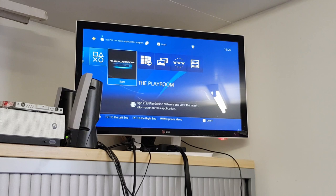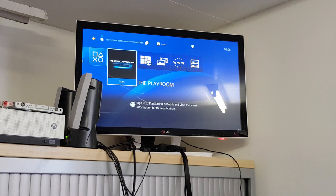Yeah, you can hear that. Yeah, the disc drive isn't happy. It's not accepting this now. It's not feeding. So it would appear that the drive mechanism is out of line. So what we'll have to do with this one, we'll have to crack the drive apart, realign all the... Probably somebody just ragged a disc out of it, more than likely, which is why it's happened. So we'll go away, we'll clean the laser, we'll sort the drive mechanism, we'll plug it back in, fire it back up, and we'll see what we get.